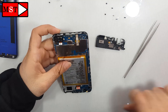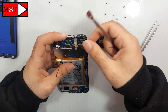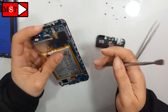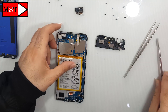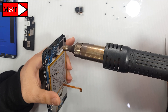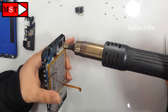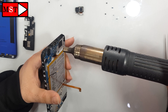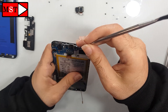We need to remove the screws from it and remove the board gently. There is adhesive at the bottom of the charging board — you need to heat it for about 20 seconds so you can remove it easily without breaking the board. Remember, don't do anything stupid.